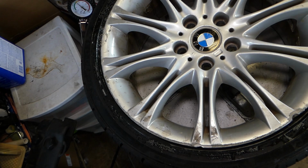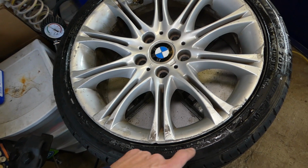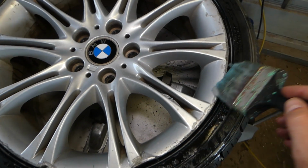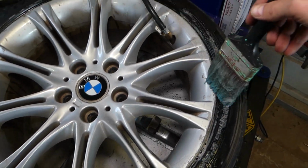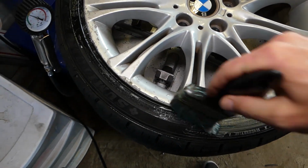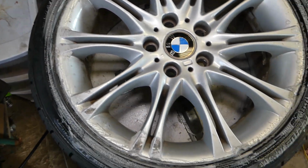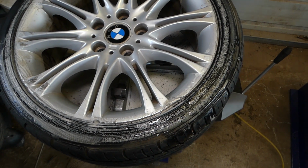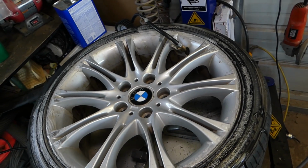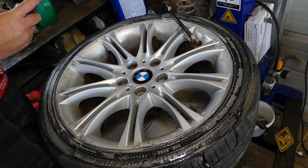We're at 42 psi, and right now I don't see any more bubbles coming out. So we're going to put a little bit more solution here to check for leaks. Nothing, everything sealed great. So you can see, sometimes the peeling paint, broken bead, defective tire or dust deposit can cause that. So definitely we're ready to go.